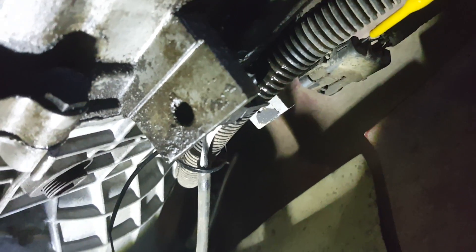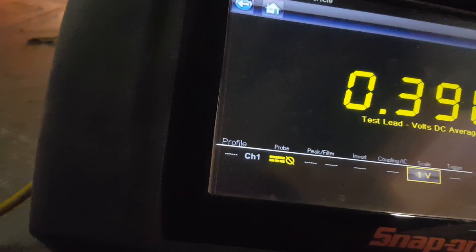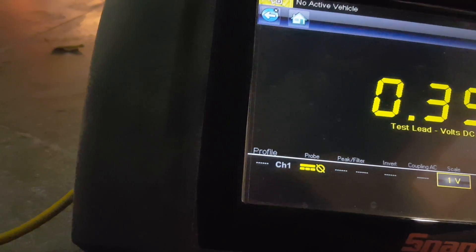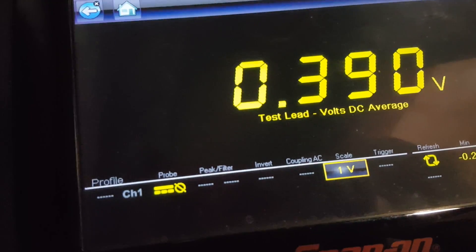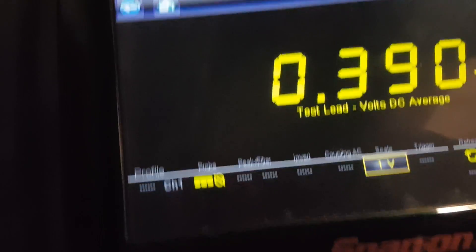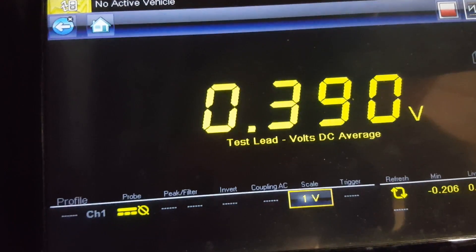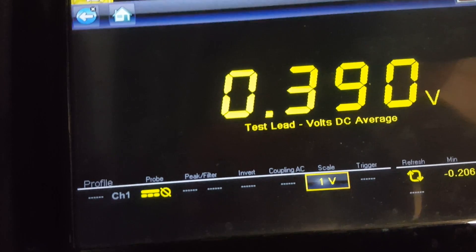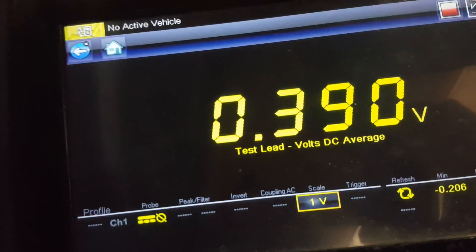Under the car I got the O2 unplugged. I'm on the harness side, back-probed on that sensor wire — there's the other connector that goes to the O2. And as you can see on the voltmeter, almost 400 millivolts — that's coming from the computer down to the O2. That kind of threw me for a loop at first, but that's the bias voltage. You can do this with just a voltmeter — you don't need a scan tool. If you unplug it and see that voltage on there, that means your wiring is good all the way up to the computer, so you don't have a wiring problem on your sensor wire.